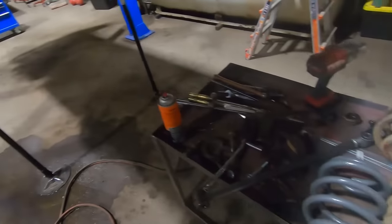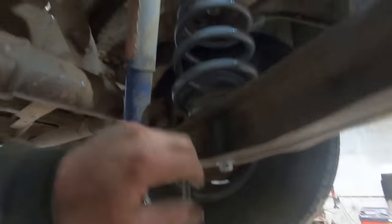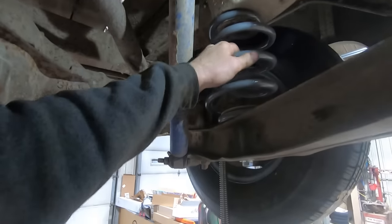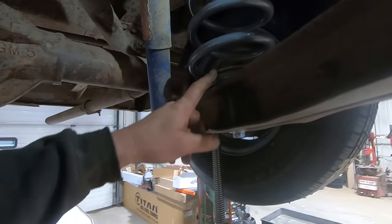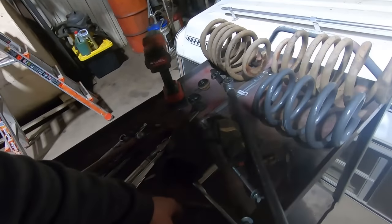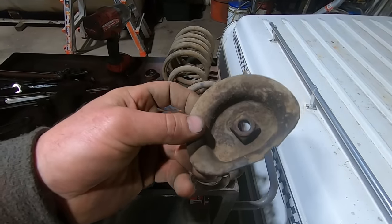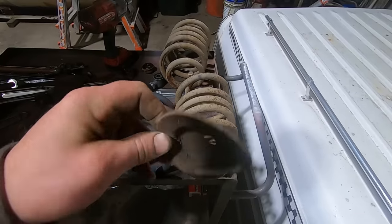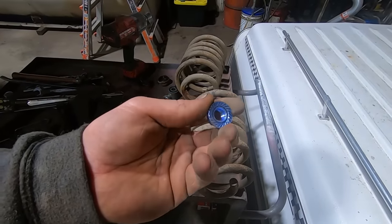So you can see I only got one here because I got the other one in here. I got some new hardware, half inch bolts top and bottom. Put a whiz nut up top so I didn't have to hold it. That was pretty freaking handy. There's supposed to be an encapsulated nut on this D cup here, and we just used a whiz nut on that. Let me show you. So yeah, the bottom ones have that encapsulated nut, but the top ones and now the other bottom one are just like that. So we just used a whiz nut on there, is what I call them,